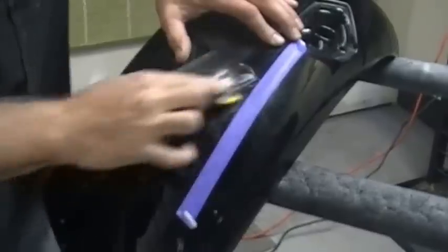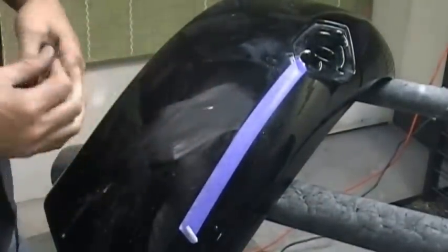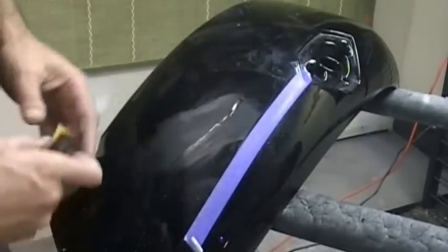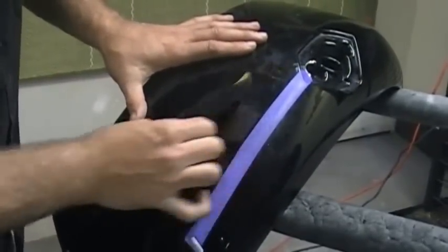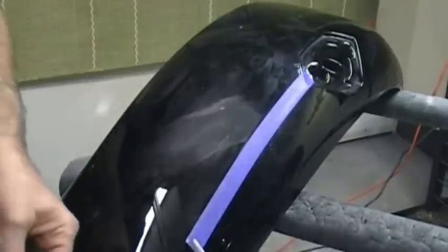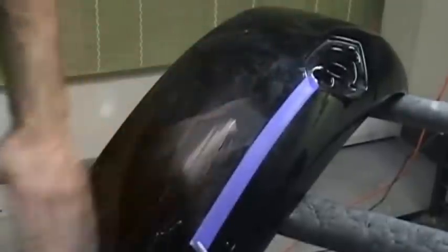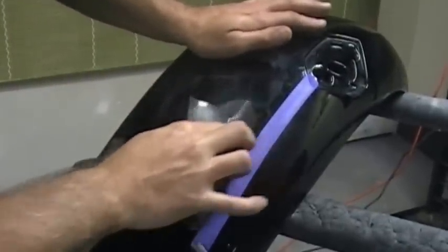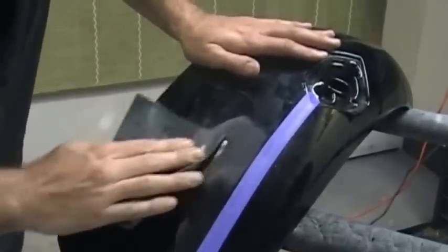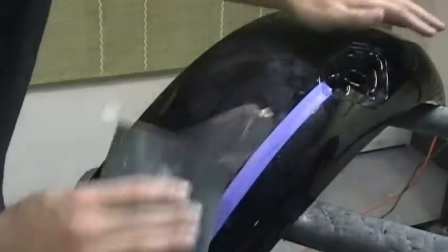I am going all different ways here and being pretty aggressive. That scratch is virtually gone — just a little bit right here. And again, different way you look at it in the light, you are going to see it. Now I probably could take some 600 or 800 grit and get that scratch out much quicker, but I do not want to do that because you do not have any room for leeway if you screw up. This is exactly what you do if you took it to the body shop. I had a body shop and did this stuff for 30 years. This is how it is done.